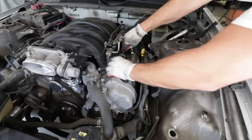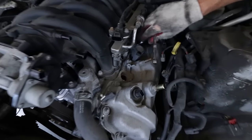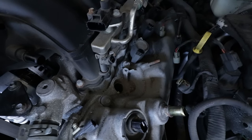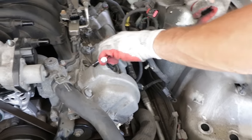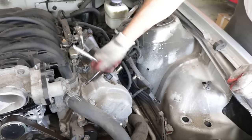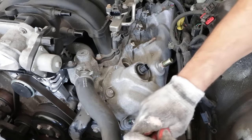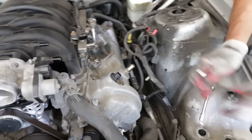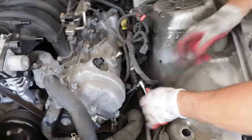There's a surprising amount of sand in the spark plug area — holy cow, look at all that. Time to pull the valve cover bolts — eight millimeter, and there are a whole bunch of them. The top side is going to be easy; it's the bottom that'll be a struggle. This is V8 life — you get more of everything.